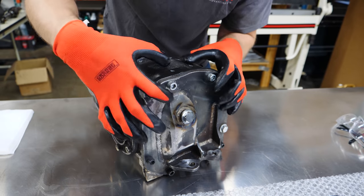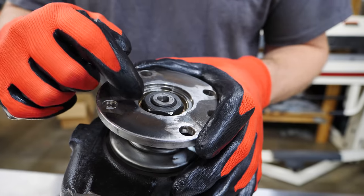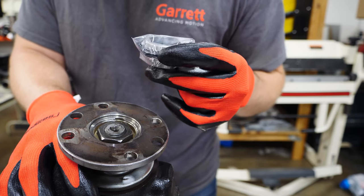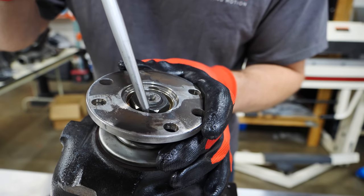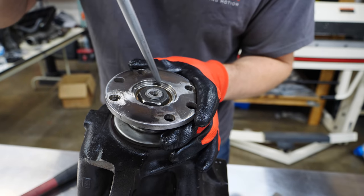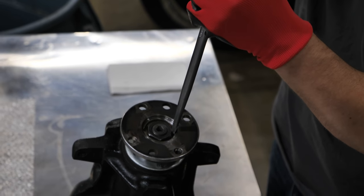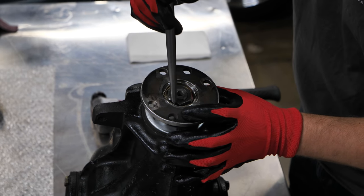There's our custom front cover, just barely big enough for the tight packaging for the all-wheel drive rotor. I'm going to take this off and get the nasty gear oil out of it. The very first thing we need to take out — thankfully I got this kit — is this piece right here. The BMW German engineers put these two areas here for us to basically push that out of the way, bringing the rest of that ring inward to remove it. But that's actually preventing you from getting a socket in here, and you can see somebody at some point tried to do that. It's not a very reusable design. The ring is actually ready to go — that quickly. I'm impressed.